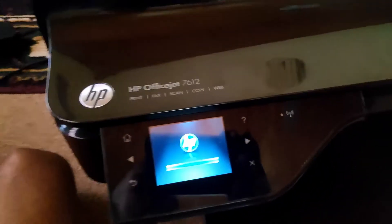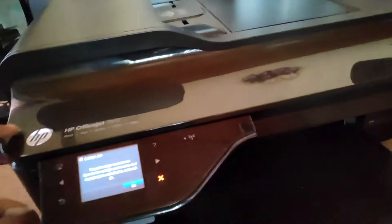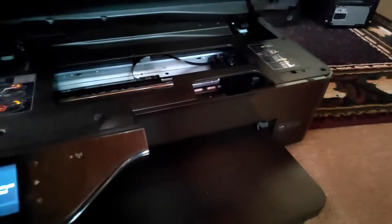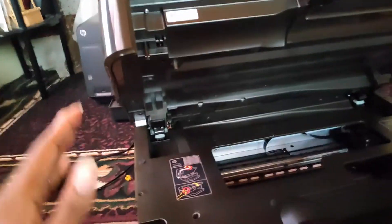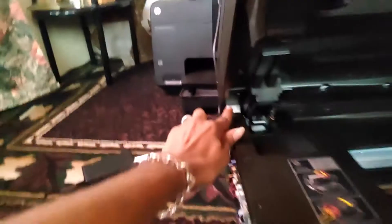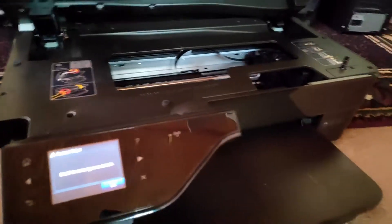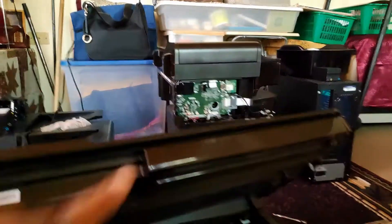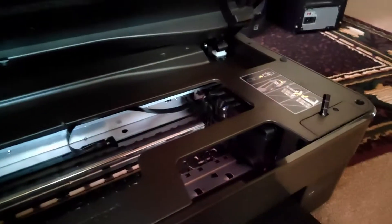The main thing I'll be checking is whether the carriage tray moves at all. I'll raise it up and put this here. It shows carriage jam — press OK — and unable to scan, scanner failure. This board has different firmware or software for how the scanner works, or the cabling configuration is just different, so it can't read the scanner. This one has the fax feature and the other must not. Let me make the printer think the door is closed and press OK on the carriage jam — this should move a little bit.